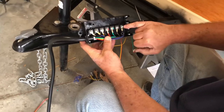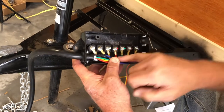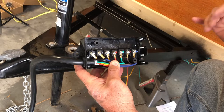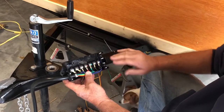Yes, actually the blue is the trailer brakes and your parking lights. One of these in here, I'll have to look at the chart, runs a constant hot back. So if you have a 12-volt battery in there, it will actually charge it off of your vehicle as you're going down the road. So seven pin covers all kinds of stuff.